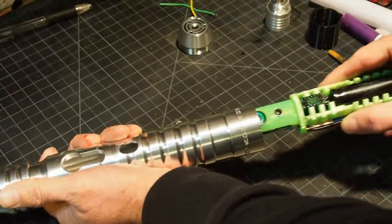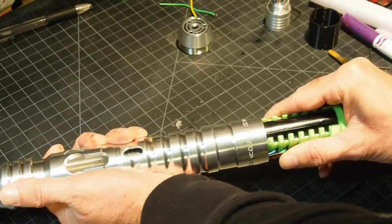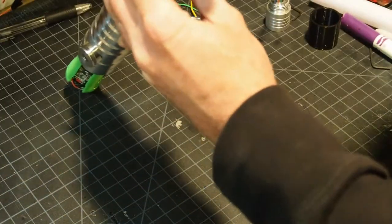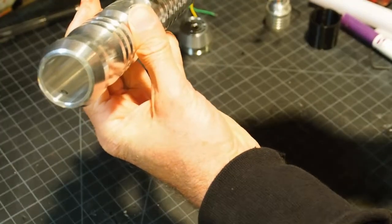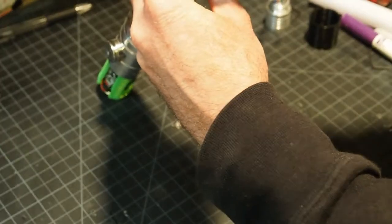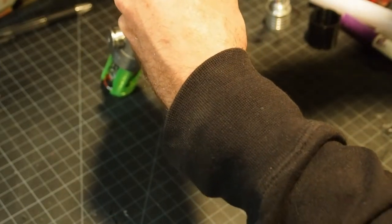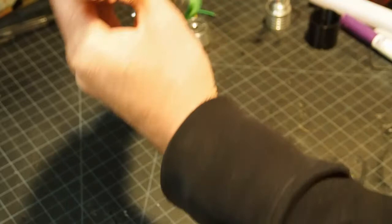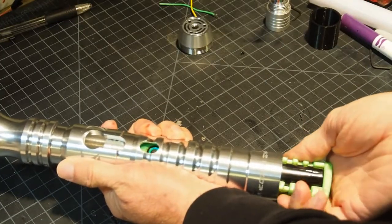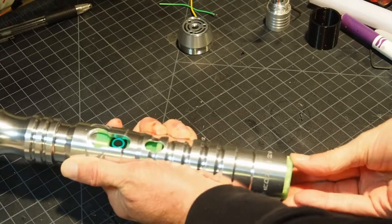This looks good. But you want to go in gently and carefully to make sure nothing gets caught as it goes. Now it's going to go in, and then it will stop because the LED heatsink hits an internal reduction in diameter. So again, use something small, gentle, that won't scratch anything. Come in here and just push the LED lens into alignment. Then you can make small adjustments as it goes in, getting everything lined up, pushing it together.